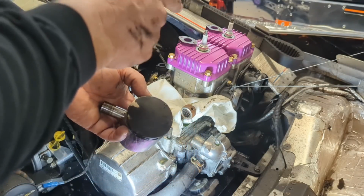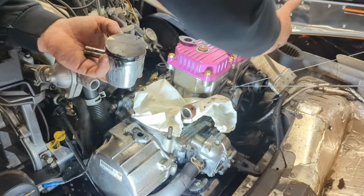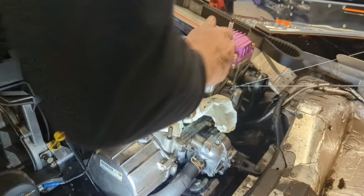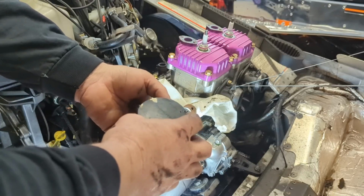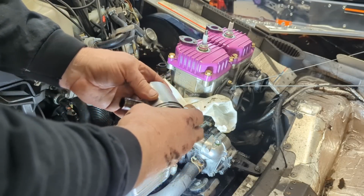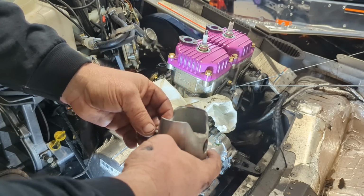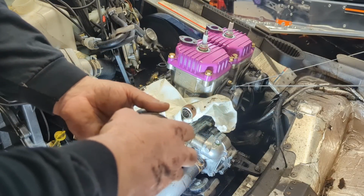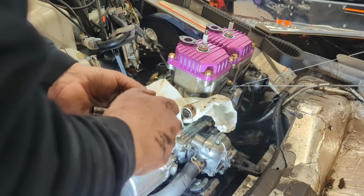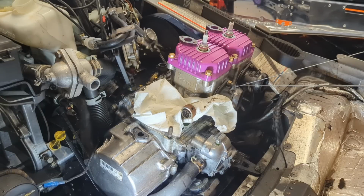So yeah, we're gonna go up one jet size. So we're 380, 380, 390. We're going to be 390 straight across because this cylinder seems to be loving that 390. I would not have expected to have to jet up after we jetted it. I think that day when we jetted it was 5 below out. But we did run it on a day when it was 45 or 50 degrees out, and it was running really good that day too, wide open. So she was probably running too lean for it to run that good on a 50-degree day. That should have sent some alarms off for me.